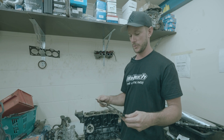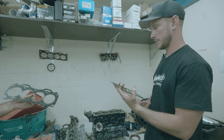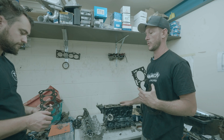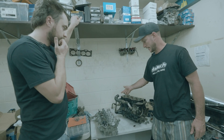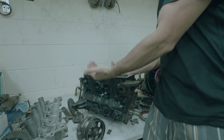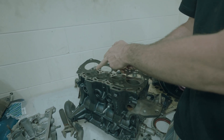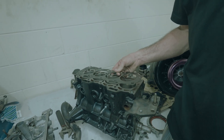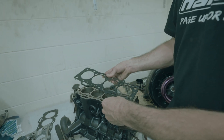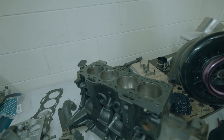We tried to contact Cometic — it just seems near impossible to get them — so we're trialing these ones now, and they are in the Camp Dog store if you want them. They're a little bit different to the usual Cometic ones. Everyone knows the 4A and 5A Toyotas are known for overheating and high water temps. We've been trying to figure out for ages why: the water pump picks up water from the bottom of the radiator, comes into the water pump, goes up into the block. The problem with the old gaskets is there are no holes at the end for water to come up into the cylinder head — it's getting trapped in cylinders three and four, which always seem to be the cylinders with bearing and detonation problems. So we're hoping these extra holes will increase water flow a little bit. Maybe there's an air pocket in there that's boiling. We don't know, so happy to try these and see what happens.